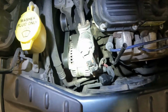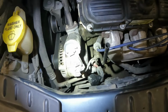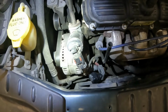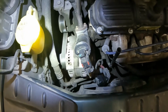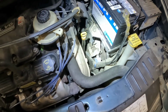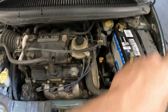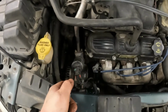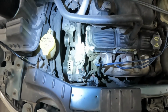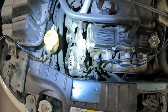If you're condemning an alternator, if otherwise it's charging but they're saying it's not charging, don't forget to look at AC output. Sometimes it's putting out too much AC output, and say you have speed sensors on a vehicle, like transmission speed sensors. If they're 2-wire speed sensors, then they will put out their own voltage, an AC sine wave. If the diodes in the alternator are cooked and it's putting out too much AC voltage, it can actually overpower those. So you can get stuff like the vehicle thinking it's moving when it's not, just because of that.